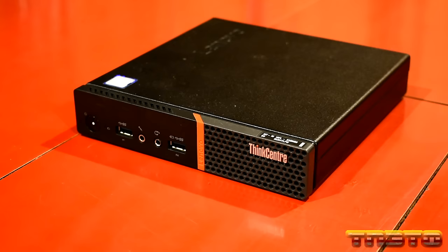And this also has Intel vPro, okay? We'll get into Intel vPro later, but that is something that's either scary or something that's really cool. So we will explain that later, and that will actually probably be in a separate video. I will go over Intel vPro and what AMT is, okay? Intel AMT, basically, in short, allows you to remotely control computers similar to an IPMI, okay? It's not a full-fledged IPMI like on a server, like iDRAC or iLO. It's not that advanced, but it at least does give you a KVM and allows you to do a couple neat things. And that will depend on what CPU you put in this. There are several CPUs that can go in this unit that support vPro, and the chipset of the motherboard in this unit supports vPro as well.